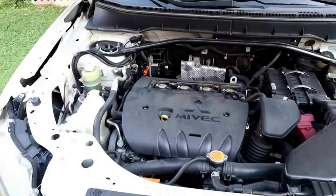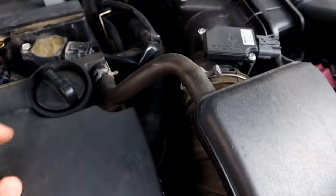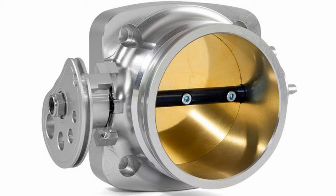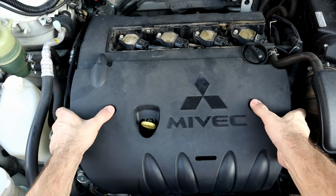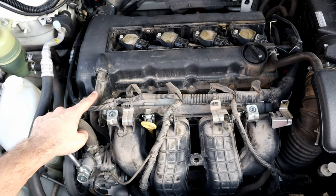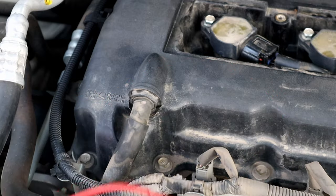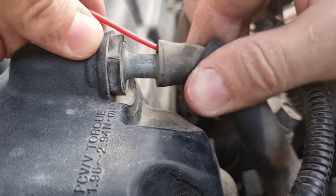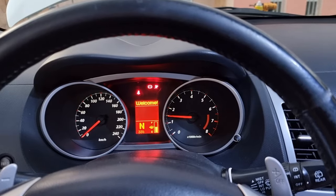So you can find whether it's the spark plug, fuel injector, or ignition coil causing the problem. For cleaning, we're going to run the engine and spray carb cleaner from a PCV vacuum hose — but not from this side, because it goes to the mass airflow sensor and throttle body, and the carb cleaner will damage them. The other PCV hose, under this cover, goes directly to the intake manifold and then the combustion chamber — that's the vacuum hose we're going to use. Insert a straw like this into the hose and then put the hose back again.